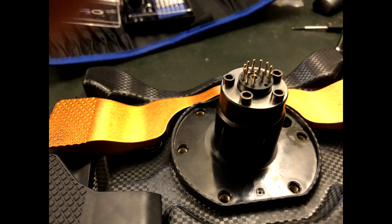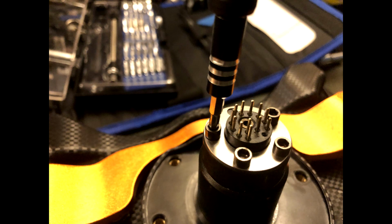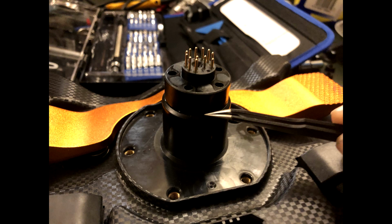This will expose the pins. You can clearly see my missing one now. Undo the 4 3mm Allen bolts holding the collar to the wheel and take off the metal plate. Now undo the 2mm Allen bolt in the middle which secures the centre to the cover. You can lift the cover carefully off now and set it aside. This is where it will split from the body of the rim.